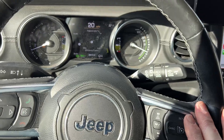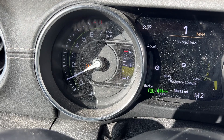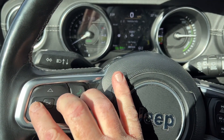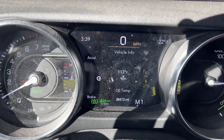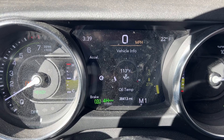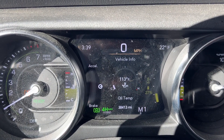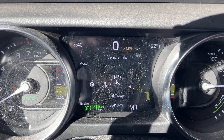I'm at a traffic light now and I don't want to see this engine shut off since I just started it — I want to keep it running and coming up to temperature. If you hit your left arrow button you can get into the vehicle information and see your oil temperature; I've got it at 113 right now. We're going to want that to get up into the 180–190 degree range if at all possible, because at those higher temperatures it burns off any excess fuel that made it into the combustion chamber and is trying to make its way into our oil.